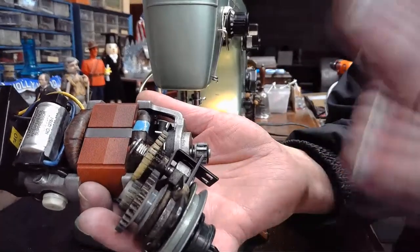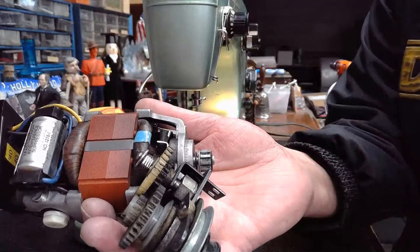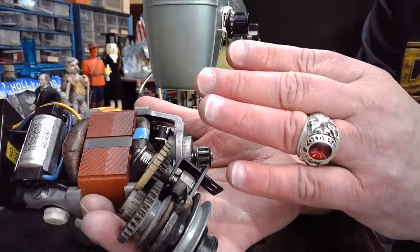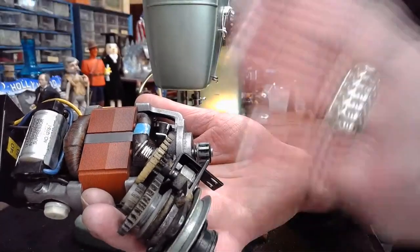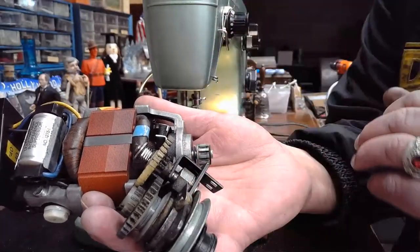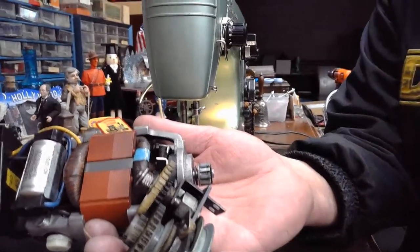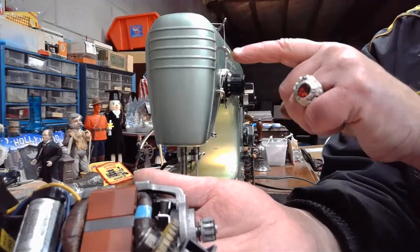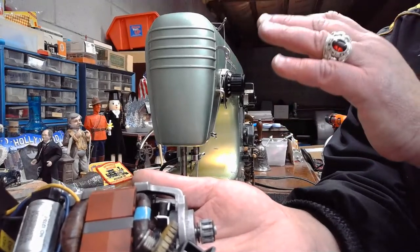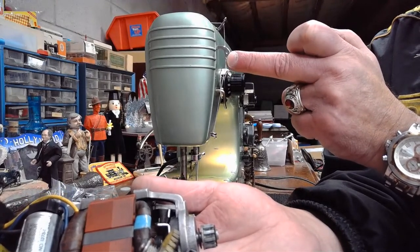But again, if a machine is properly serviced, and to AW's point, you've got proper belt tensioning on it, until that belt starts to get glazed and ages in place and starts to wear, you're going to have real good launch as well. As long as you follow a basic principle, and I'll just kind of raise the camera a little bit. As long as you follow a basic principle of never, ever launching with a Swedish Beauty where I am right now. See where that take-up arm is way low?